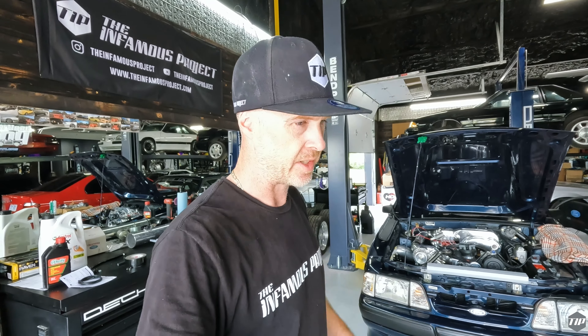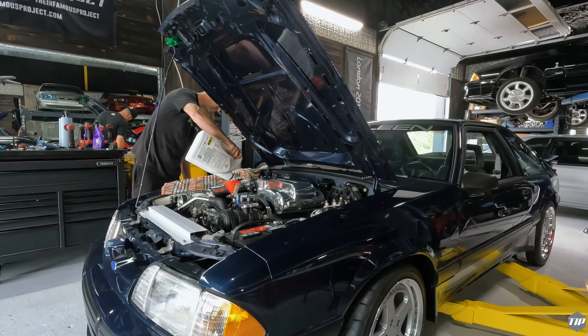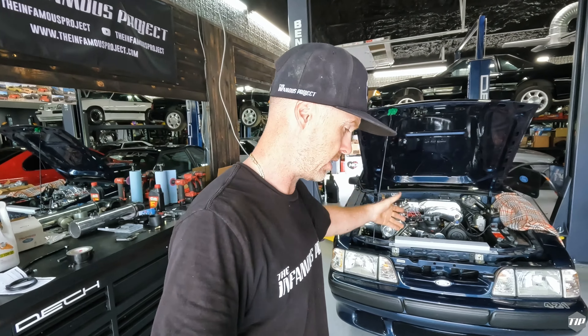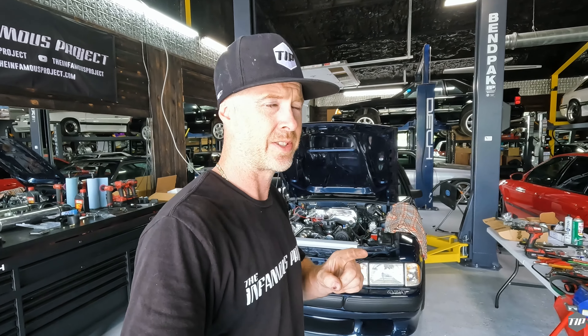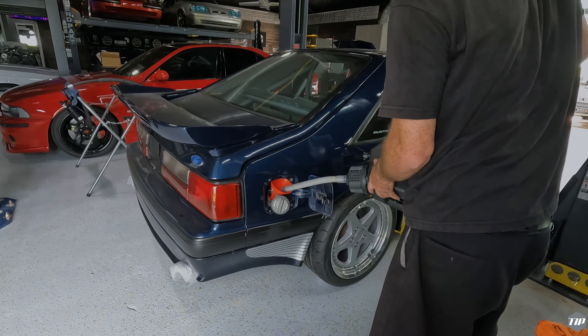In the last video we went through a lot of the tedious things — exhaust, accessories, wiring, and the cooling system. Fluids are in the car: coolant in the radiator, and ATF in the power steering pump. That's debatable these days — check your owner's manual, you can run ATF or power steering fluid. I've always run ATF because it's kind of a universal fluid. The oil's in the motor, we've got fuel in the tank, all put in yesterday.